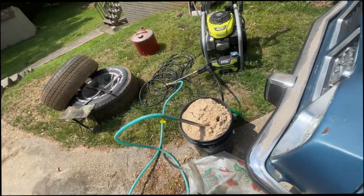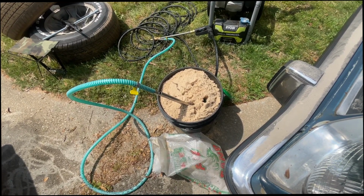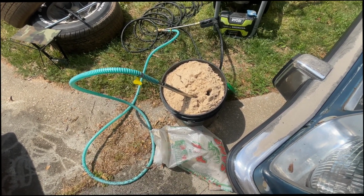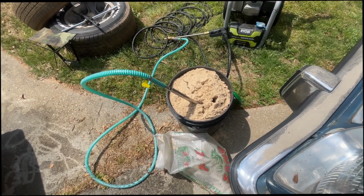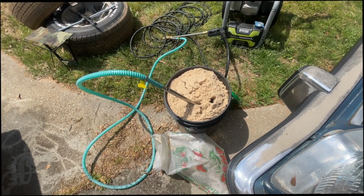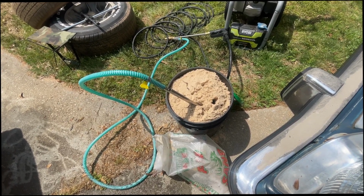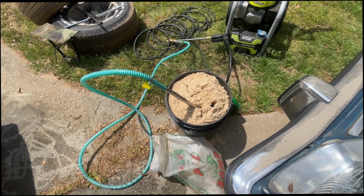So all right people, I already gotta stop. My sand is moist. Moist sand clogs the sandblaster. Oh man, so I gotta let the sand dry out. Who knows how long that's gonna take. So, yeah, we'll be back.